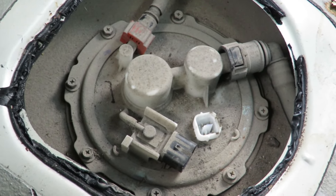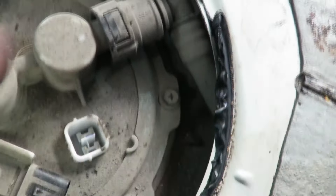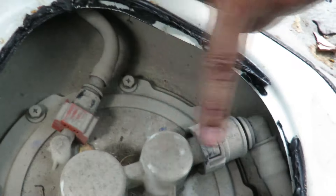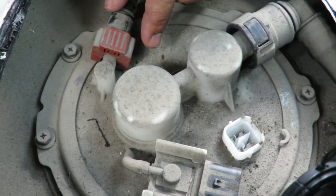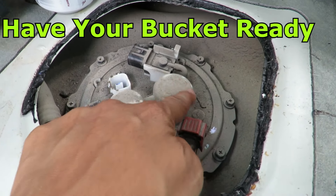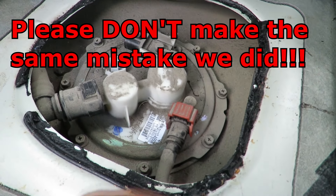After you remove the electrical connector — it will swing out of your way with that plate — we're going to release the fuel lines. There's the main fuel line and the return line. Take that orange cap and raise it up with your fingers. Since it's dirty, take some wipes and clean the area before doing anything else.